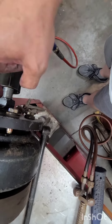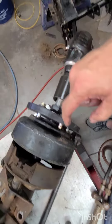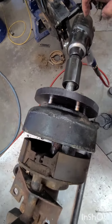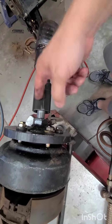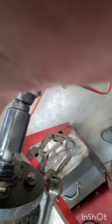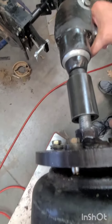I'll let the air catch up, it's taking too long. I had to put a ball bearing in there and then a socket, because this bolt here is not long enough to take out this long hub. I couldn't find a long enough threaded bolt, but this will get me there.